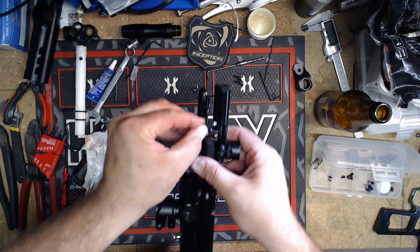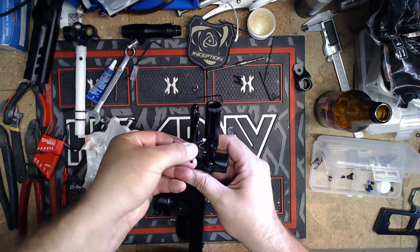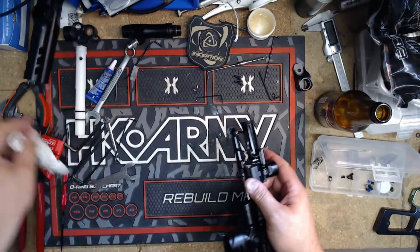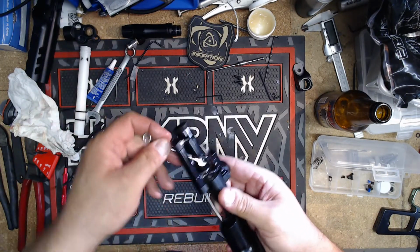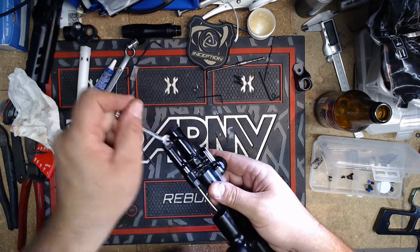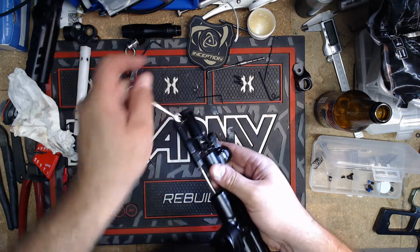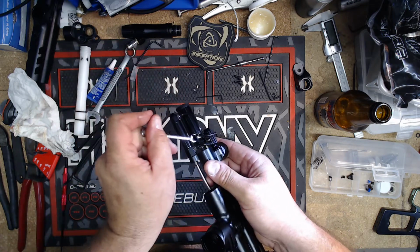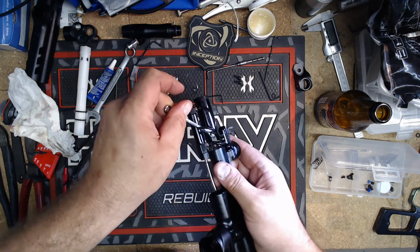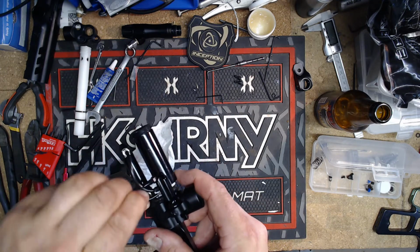We're going to go in here, and it's nice that I have the hose already on this little fitting here. It gives me something to spin this fitting without having to get my big mitts down in there, and it gets me started. And then it's a 1/4 inch for these Resurrections. 1/4 inch end wrench works great. Go down to your Sears, Home Depot, Lowe's, Ace Hardware, True Value, whatever your tool place is, they should have some micro wrenches there, the small ones, 1/4 inch. I like this Craftsman one because they're all polished and there's no sharp edges on them, so I'm not really worried about damaging the anodizing on it at all. And get that guy in there.